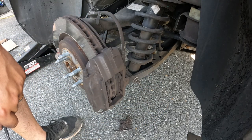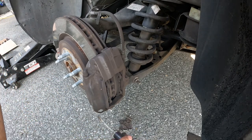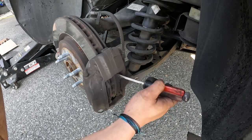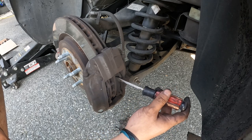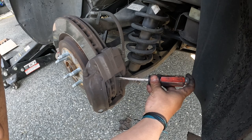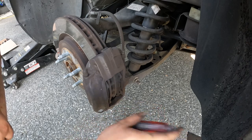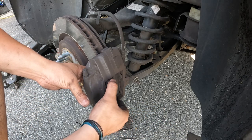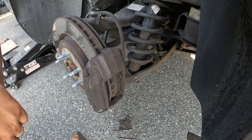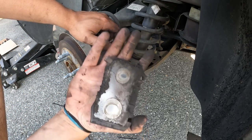This side is a little tougher to record but I'll try to get you as close as I can. Same deal — knock these pins out. Got those. On this back section we're going to do the same as before — use the rotor and this little section here to leverage the pads down. I've got my screwdriver pinned on the rotor, press on the pad, and depress that piston. Just like that — now I should be able to slide these out.